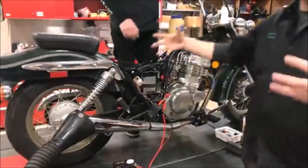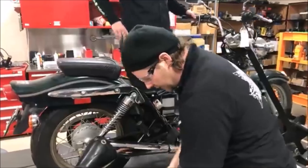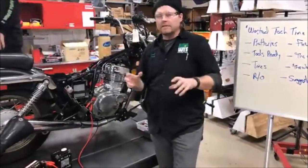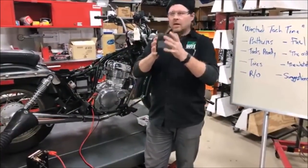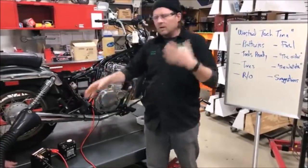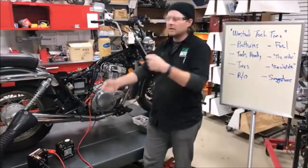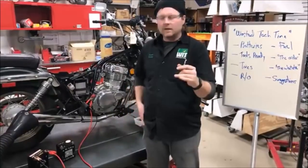Have you ever done this before — you're all the way ready, you want to get going, and you hit it again? We got nothing. We got a bad battery. This will make sense what we're gonna do here. There is no point in grabbing bad batteries. We don't even have it bolted in because we're still diagnosing, trying to figure out what we got going on. All this does is waste time — you had to go get this battery, it's not gonna work, then you grab a meter and test it, spend more time, and then you go: battery needs charged.